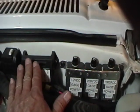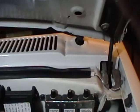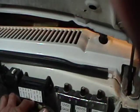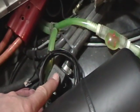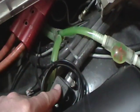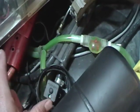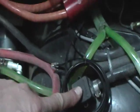This is now energized because the ignition switch is on, it's coming through the relay. I take the power to the relay through the fuse. It comes down here, goes through this vacuum switch. This vacuum switch is normally closed, so that means the contacts are closed until it reaches about 18 inches of vacuum. Then the switch opens to shut off the pump — this is low vacuum.